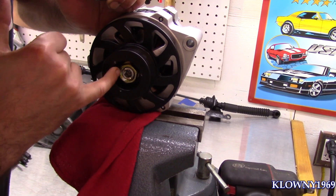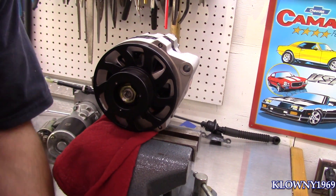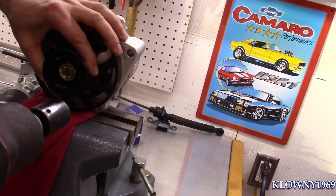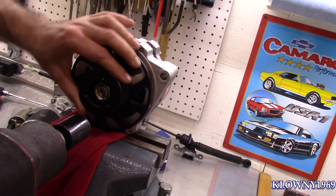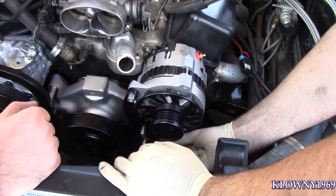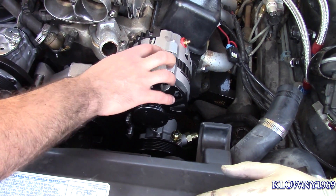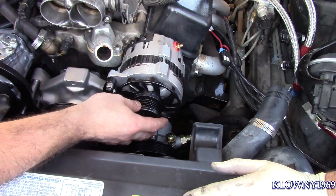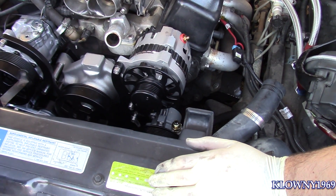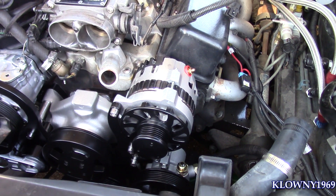You can see I gotta go from here to here now, and that's gonna be tight. Just a little more and we're good. We put it back on the car — as you can see it spins freely. That's one thing to check, because sometimes it gets cockeyed and you have to straighten it back down. It's clearing and it's all good. That's how you clock an alternator. Thanks for watching — subscribe to my channel, like, share. See ya.